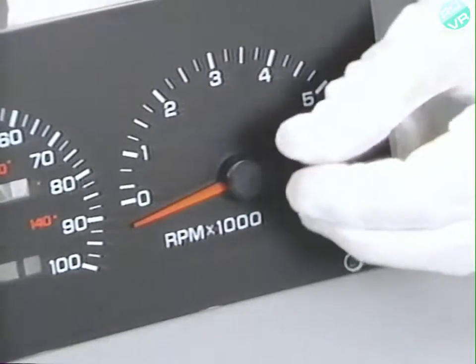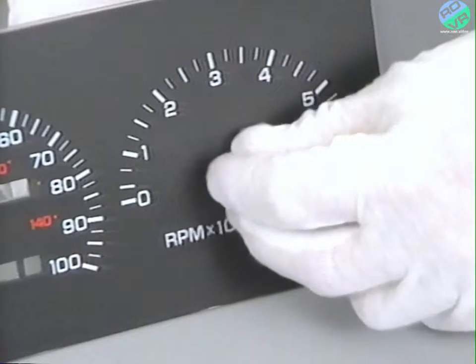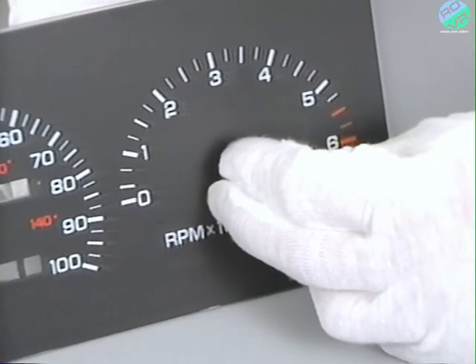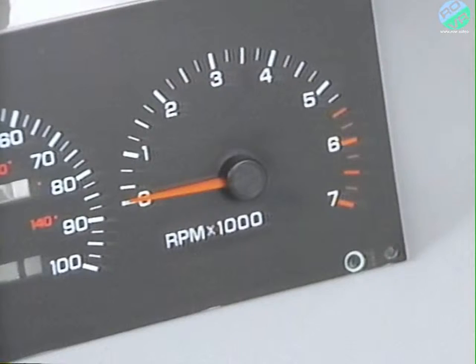If it's too low, rotate the pointer assembly clockwise until rotation resistance is felt. Continue rotating clockwise to compensate for the initial misalignment. Release the hub, allowing the pointer assembly to rotate back to its rest position. If alignment is not achieved, repeat the procedure.